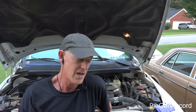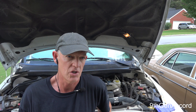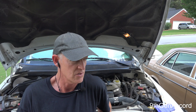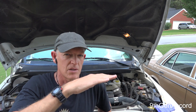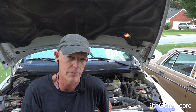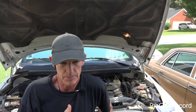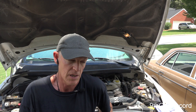The problem is if you have a Carter pump and it just doesn't make any pressure, you can crank until the battery dies. I've replaced the fuel filter before and just couldn't get it to prime the filter housing, and ended up having to replace the pump because it was tired. What happens is the pump slowly degrades and the injection pump ends up pulling fuel directly from the tank — that's not how it's designed and it's not good for it. That's why there's a booster pump to draw fuel from the tank and pressurize the line up to the injectors.